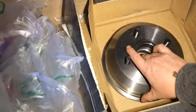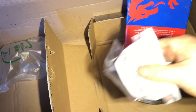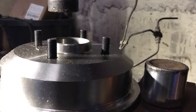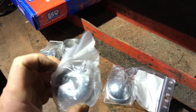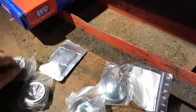Let's have a look inside the box. I've already opened it — there's a brand new hub, a set of wheel bearings, and a dust cover. So the first job is to push the outside of the bearings — the outer races — into the hub. Both bearings are the exact same size, so it doesn't matter which way around they go, as long as you can get the race in and the bearing in afterwards.